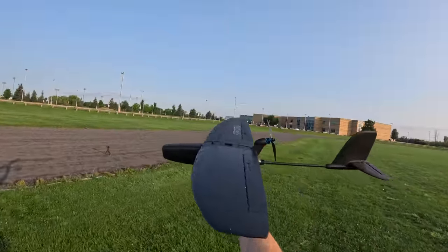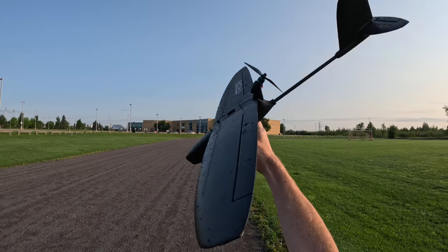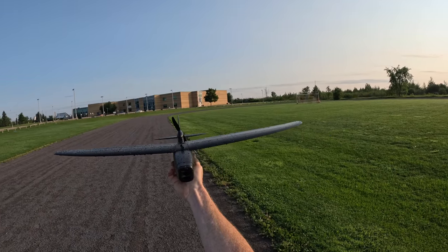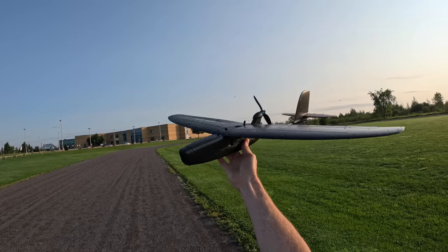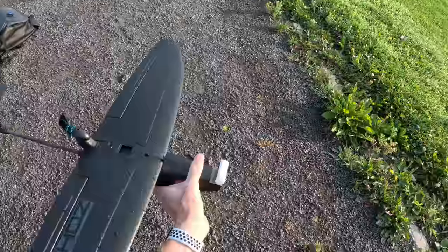According to the CG I had everything balanced perfectly, but I did have it going up and down — I call it porpoising. You could get it to go pretty stable, but every now and then it wanted to go up and down. Not really sure if I have the balance exactly correct; perhaps their CG marks are a little bit off. So I might make it a little bit more nose heavy.